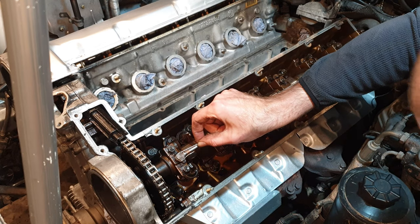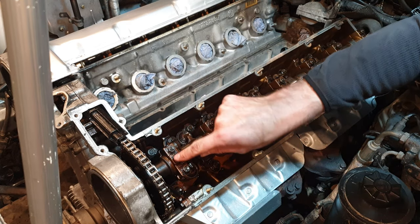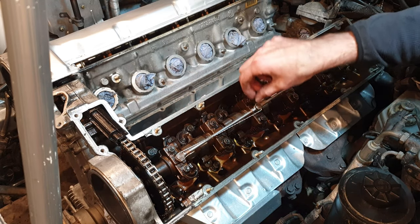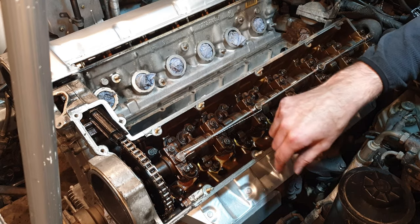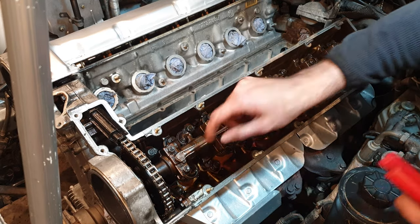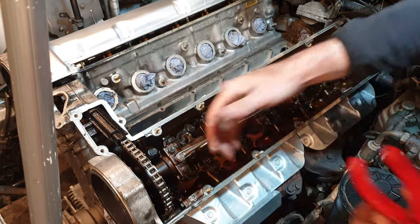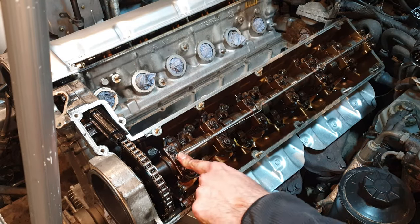And even if it managed to pull on this, this actually tightens this bolt. So it gets to a certain point where both bolts are kind of working against each other. So that's basically the idea of the safety wire. Now that it's all completed, I can just snip off this excess. Be careful not to lose the small pieces, and that's the job done.